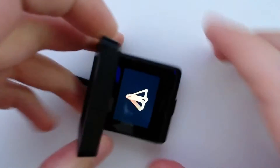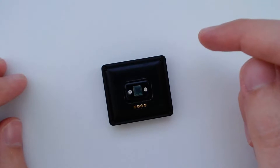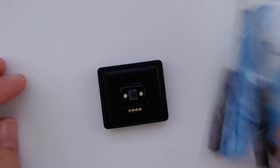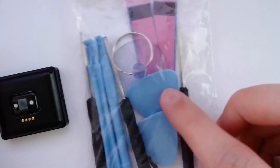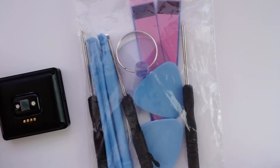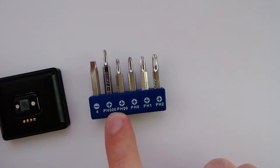So let's take it out of the charger and see how we can replace the battery. The first thing we need to do is unscrew the four screws found at the corners of the Fitbit. The kit I bought included everything alongside the battery — all the screwdrivers and bits needed to disassemble the Fitbit. If you don't buy a kit, you'll need a Torx T3 screwdriver and a Phillips 000 screwdriver to unscrew the Fitbit.